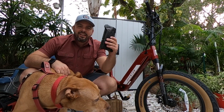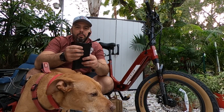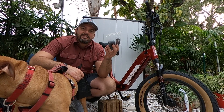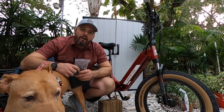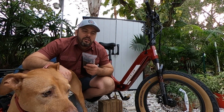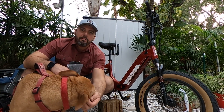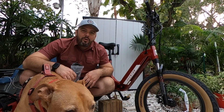I've got the Aventon fit kit from Electric All Wheel. It has the two braided extensions, the 40 amp balancer for the plus 20 amp controller on these bad boys, and then it's got the XT60 adapters in the event that this controller was manufactured prior to them switching over to the XT60 connectors. We're going to open this up and do a quick install. I don't have the key so I'm going to have to show you with it broken apart that it does light up with the extra battery. We're going to use the 48 volt 10 amp hour recommended battery that we use on a lot of our bikes and then just hook it up so you can see what it looks like.